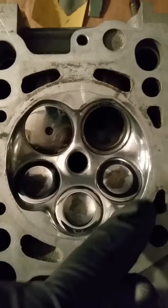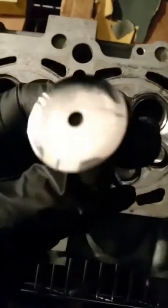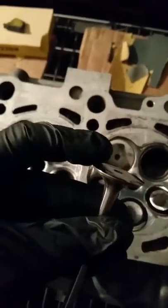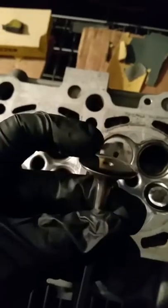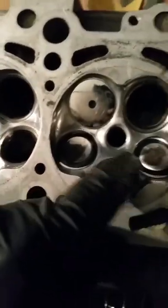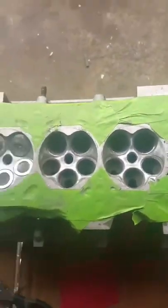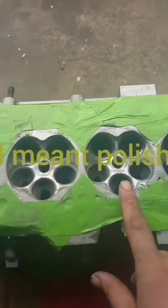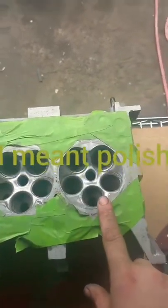One quick tip: when it comes to getting into these corners, I found it very helpful — I took the valve itself, see how the outside edge is tapered, I put the valve in a drill and took my angle grinder at about 15 degrees and ran both of them to bevel that edge. That made it a lot easier to get the tapered rolls down in there.